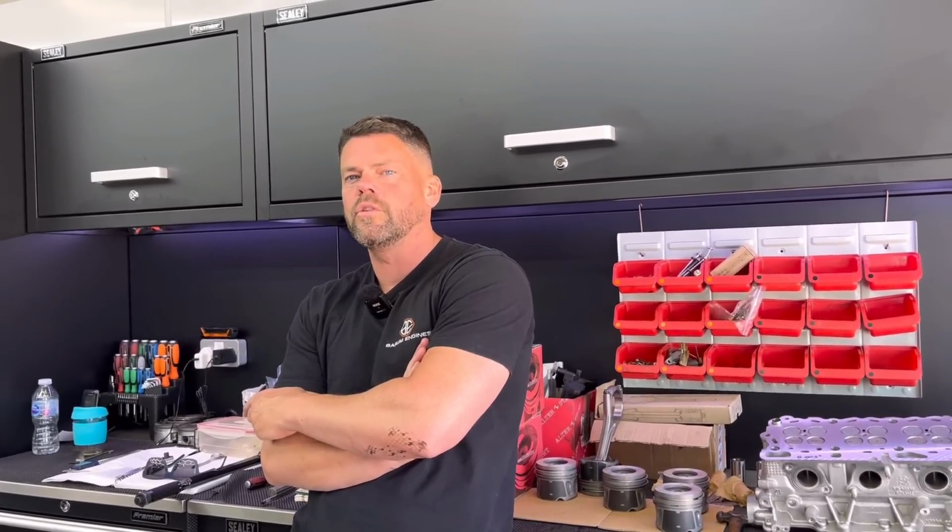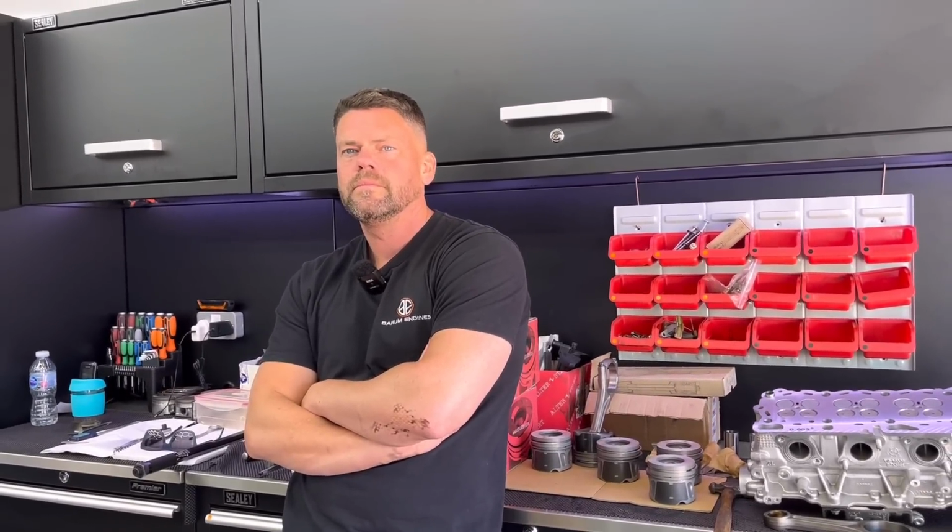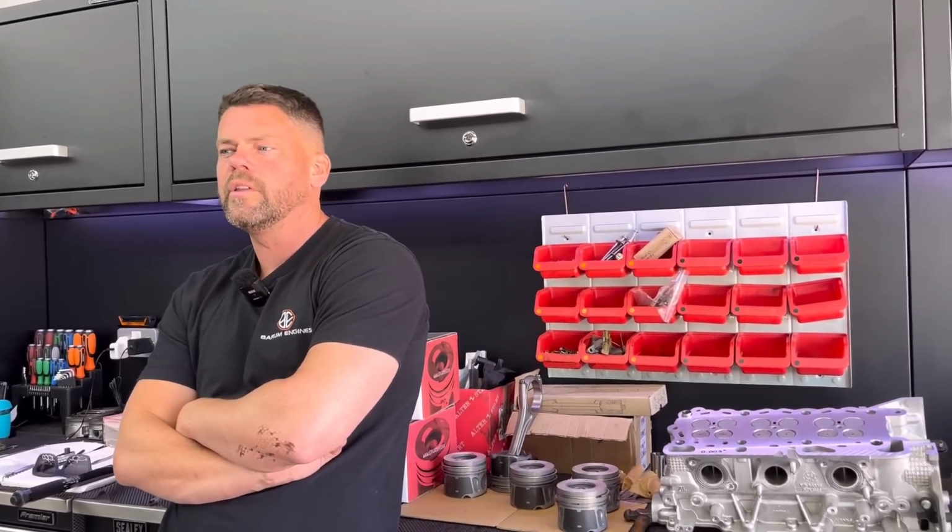It's degrading the belt and blocking the pickup in a lot of them, isn't it, on the wet belts? Yeah, if they just at least halved the service intervals, they probably wouldn't get half the amount of issues for the sake of an oil change. But are they doing it on purpose? Bit weird, isn't it? There's a lot like that. Just make the service interval shorter, yeah, and then you probably avoid a lot of these issues. I would say so. But it's almost like for some reason, they want the issues.